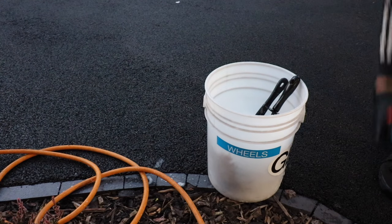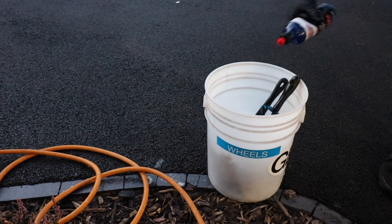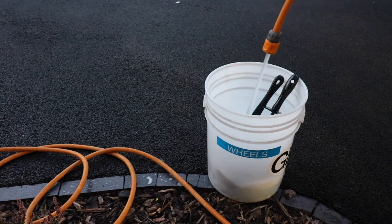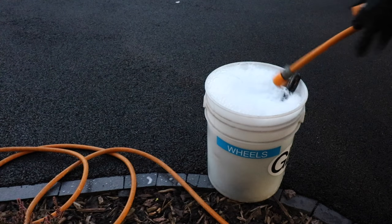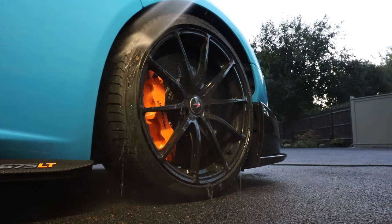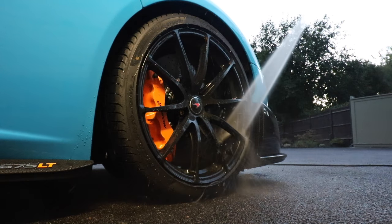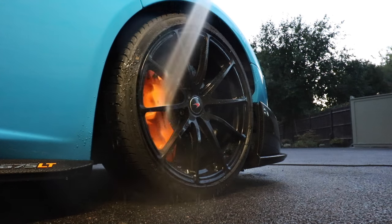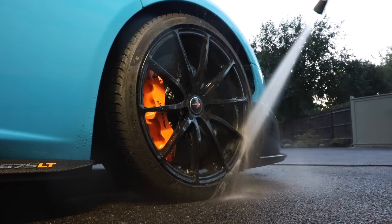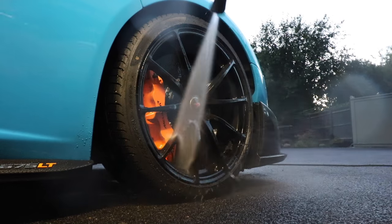As a quick outline, normal discs and pads that most of us deal with deposit strong metal filings under heavy braking. In turn, this sticks to our heated up wheels and then builds up, leaving us with a dirty wheel finish. However, with carbon ceramic discs and pads, you do not get that strong metal filing content under braking, and the dust is a lot lighter. It's an easier dust to remove. In fact, in most cases, strong wheel cleaners and gels are not needed to remove the carbon ceramic brake dust.